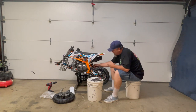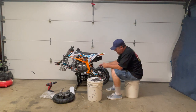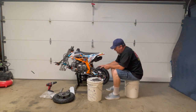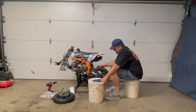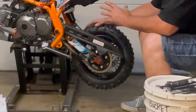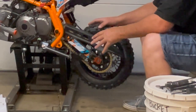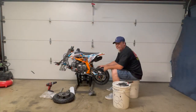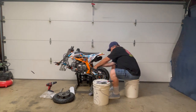Alright, we're back. So we got the rear shock that we got to mount on this. Real easy — you just got your shock here, when you lift it up you let the swing arm drop, the shock will fall right into place. Go ahead and put that in. I wanted to point out — I don't know if you guys can see this — but they updated the chain. It's one of these gold chains. This is a stronger chain, even for a little bike like this. They really put a lot of bells and whistles on it. Let's get that done right now — go ahead and pull your bolt out. There we go.